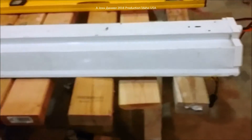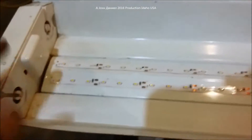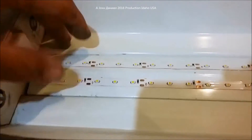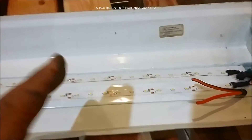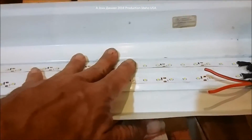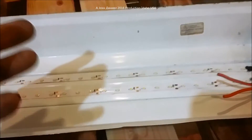This is a four-foot fixture. What I've done is removed all the fluorescent components and instead installed LED light strips. The rest of the hardware is still here for the fluorescent, but the light strips use that wire chase that clips on — stretched out a little so when it snaps in it's permanent. These are the little 32 SMD bulbs, fairly bright for what they are. The whole wattage pull is about nine and a half watts — less than an amp, roughly three-quarters of an amp — compared to a regular 1157 bulb that doesn't produce a third as much light and pulls about 28 watts, which is two amps.